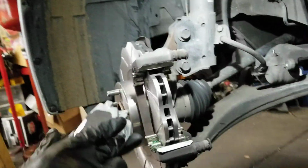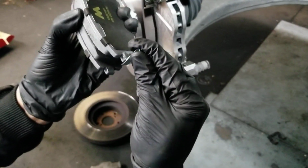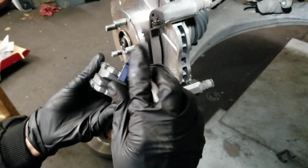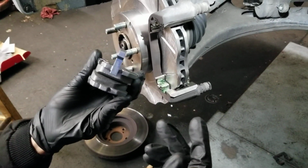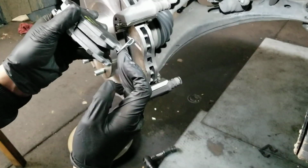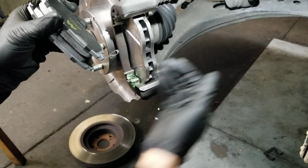And the pads. Alright, so the pads have a brake wear indicator. Thank you, Ben. Appreciate that. See, this guy is very helpful sometimes. Actually, all the time, he's very helpful. So, brake wear indicator, you want it to be in the leading edge of the pad and on the inside,